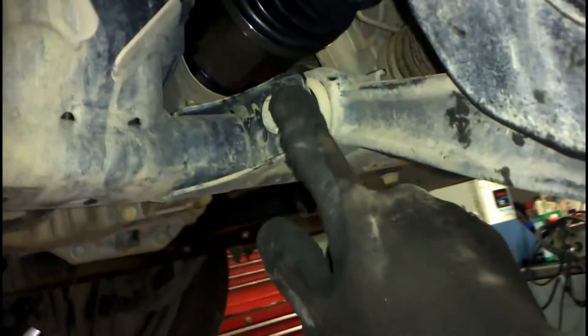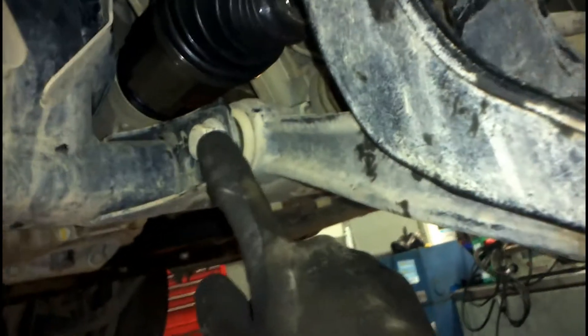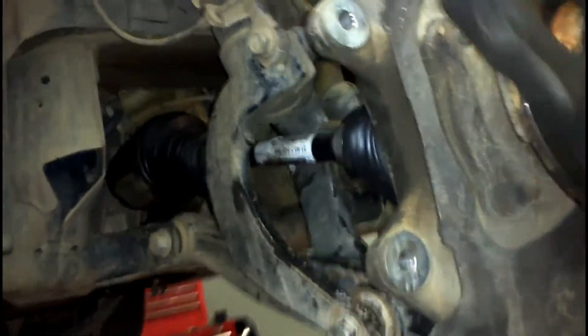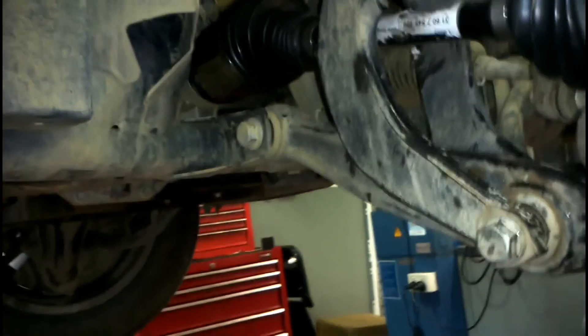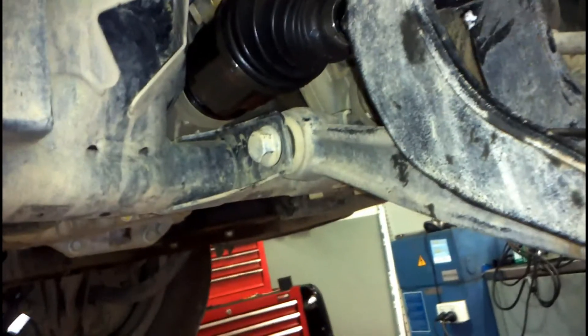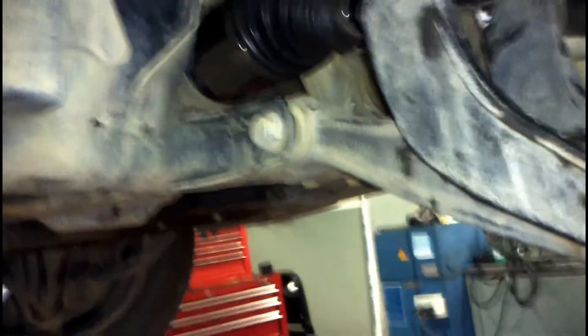We've got basically everything drafted back in. To get this ball joint in down here, I had to loosen off this camber bush, which means I'm going to have to leave that loose for now. When I put the wheel back on, I'll have to let it down on the ground and let the suspension settle — maybe drive it back and forth a little bit — and then tighten this bush up. Because if you tighten it up now, it's going to chew out quick because it's not preloaded to the suspension with the wheels off the ground.